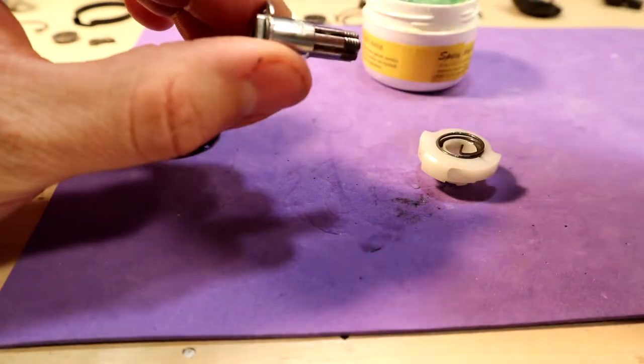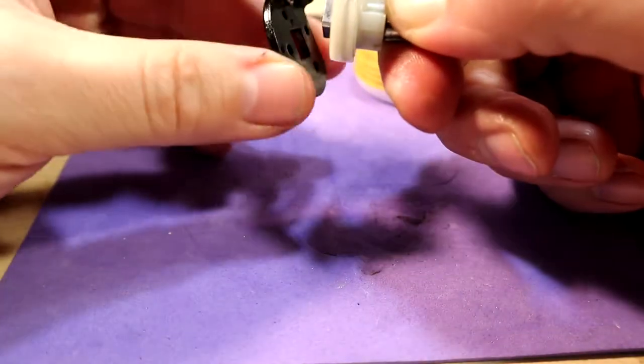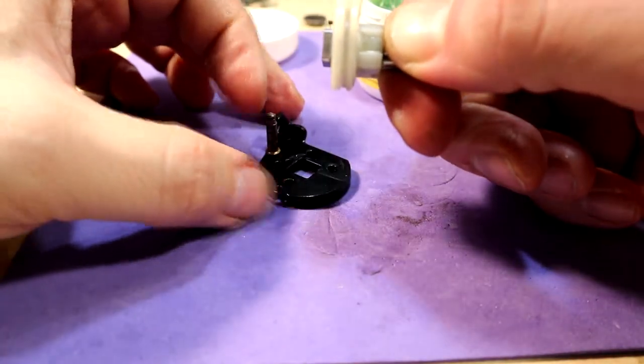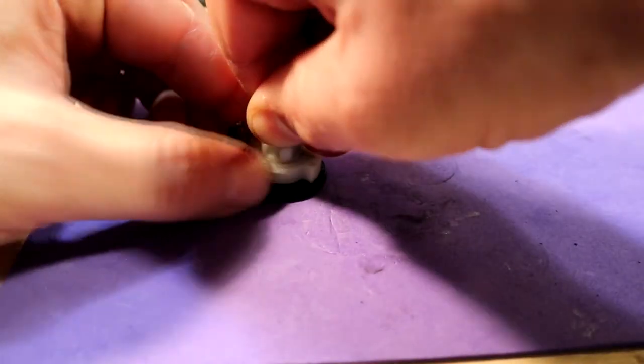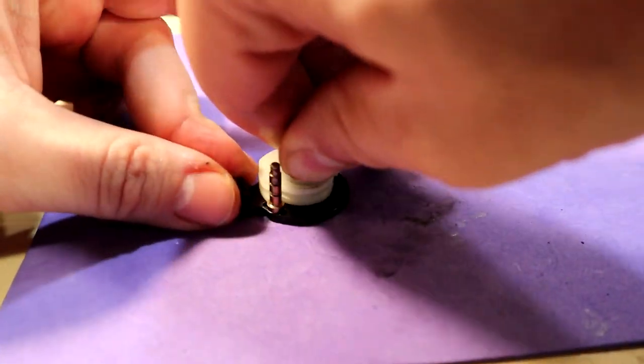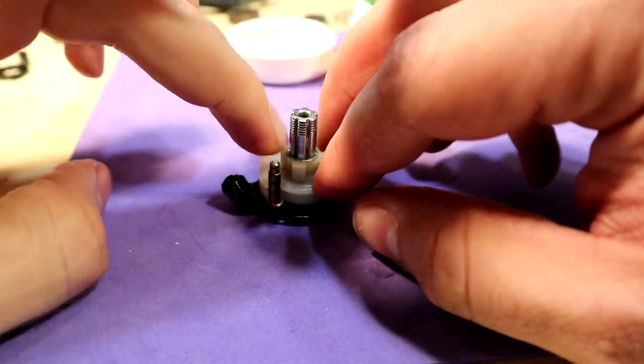The shifter lever is durable and long-lasting, but it has a problem. The grease which was used during assembly has hardened over time. And look at the parts. When this happens, the shifter can only shift down, not up, like this one.